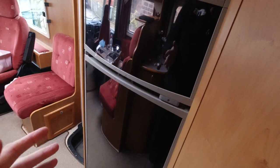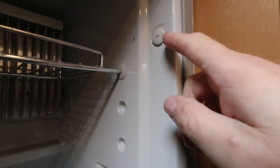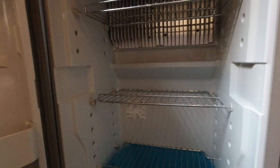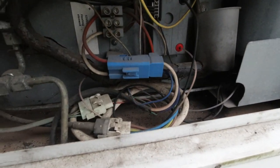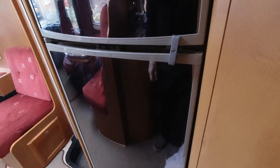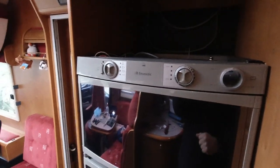I would actually say it's far easier to remove the whole unit. Removing that is just about removing these plastic bungs — one here, one there, two more on the opposite side. Behind those you'll find Phillips headed screws that screw into the woodwork through the wall of the cabinet. Once they're disconnected and you've got the gas pipe disconnected at the back, you'll be able to push the whole thing forward a little way. Disconnect the wiring — it's all on sockets and plugs — then slide the whole thing out with the help of a friend. It's heavier than it looks. The main weight is that oven and it's top heavy, so get help.